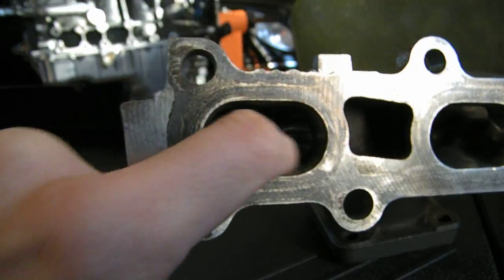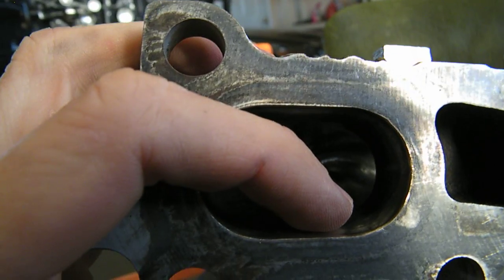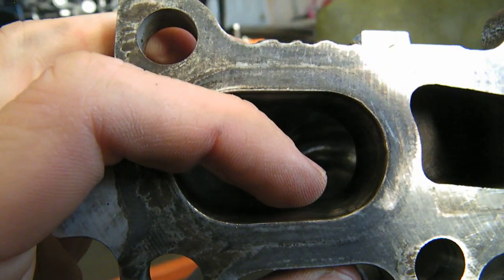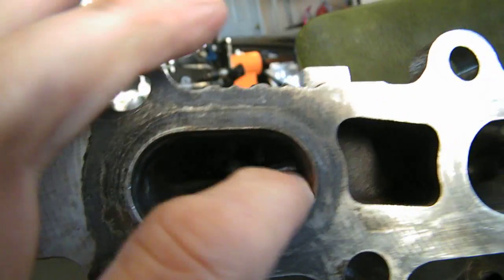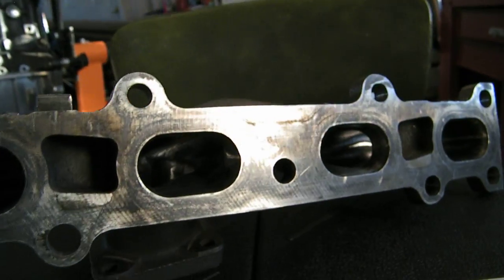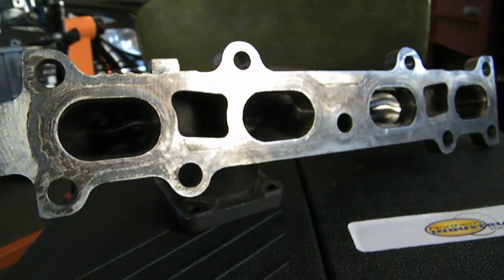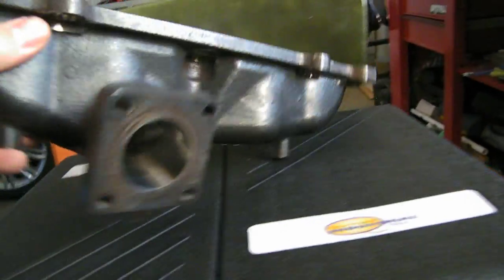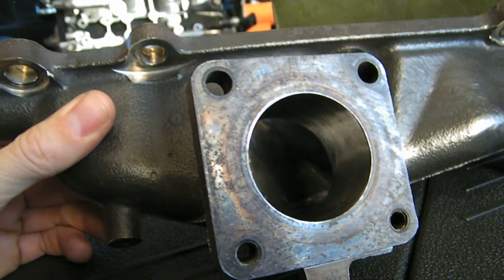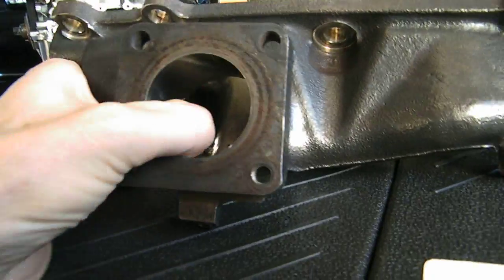But probably the main thing that I did is right here on the inlet ports — there was a lip, about 3 to 3.5 millimeters. I removed that entire lip around all of the ports, all of them, so I opened up a lot of surface area for air to flow through more. And the outlet port — I did the same thing. I removed a whole lot of material from the outlet port all along the inside diameter right there.